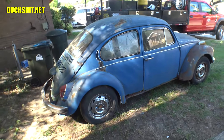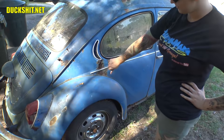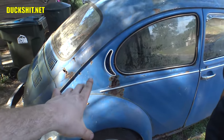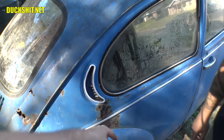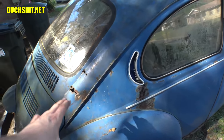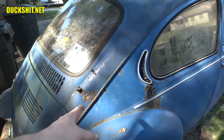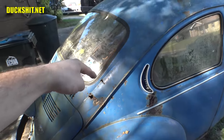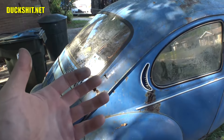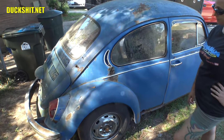Now approaching the car, the closer we get, we start to notice some problems. What's the first thing we see right over here in the back? Rust. Looks like we're looking at a rust hole. This is a car that has crescent vents on it — earlier Beetles do not have those. It's actually crumbling apart; I put my finger in the hole. So it's going to need a new crescent vent. This area on most later Beetles is a very common area for rust. The reason is this area is filled up with foam, and the foam can catch water. Especially if it's ever gotten compromised, the water gets in and soaks the whole inside area. The rust comes through the panels from the inside. You do want to look in those areas — both sides of course.